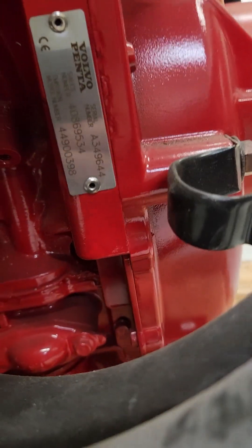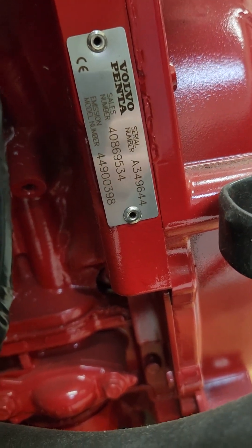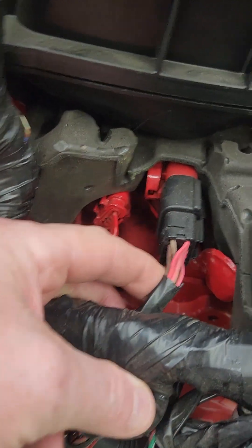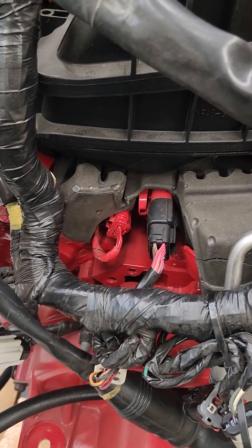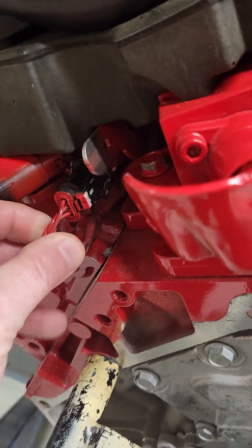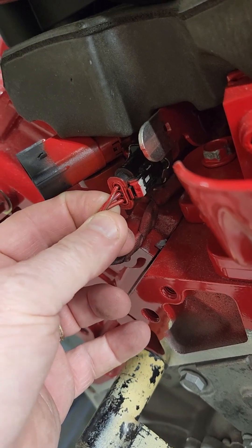Here's the 5.3 — this is an earlier model 5.3. You can't tell by the model or serial number, but if you come around the back of the engine and look at that sensor, there are four wires, and those four wires are painted over. Here again is the Volvo connection that goes to that. In the other room I'm going to show you the later model engine with a three-wire connector. Here is a teardown 4.3, a little later model, and now you'll see that the rail pressure sensor actually has only three wires. GM discontinued the four-wire connector.